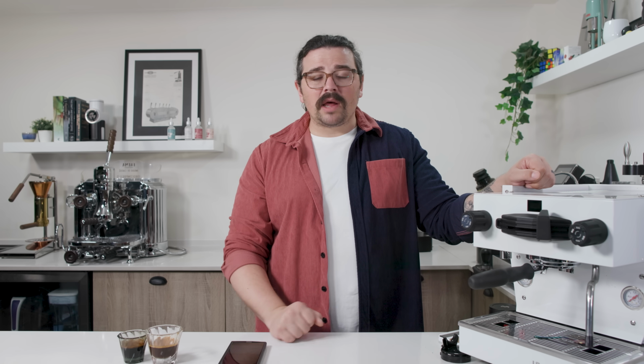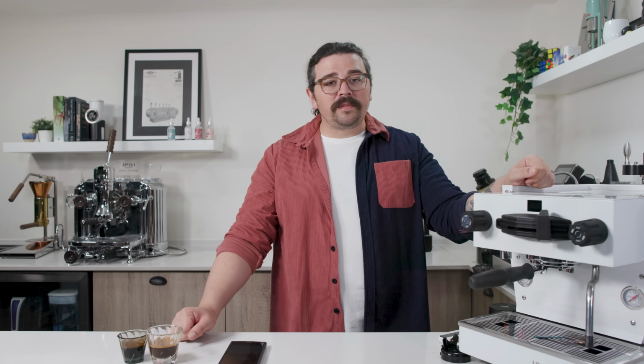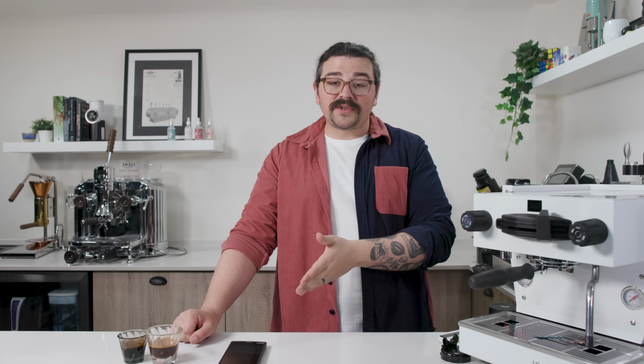There's been this obsession with getting exact temps. Like we have the World Barista Championship protocol that Gregory Skay set up, and I understand that for competitions and for cafes, but for a home user, I would bet all the things in the world that people aren't going to tell the difference between a 94-degree shot that dips to 92 and a 93-degree shot that dipped to 91. It's just not going to happen. And if it does, the same can probably be said of aberrations from shot to shot because of grinder inconsistency. Yes, it will perform differently. You need to take into account that it will be 3 degrees offset from what you set it to in your phone.